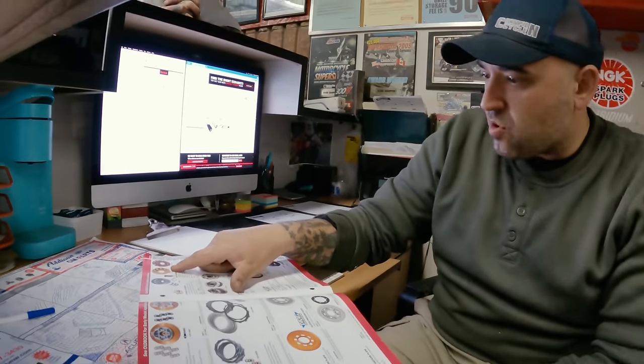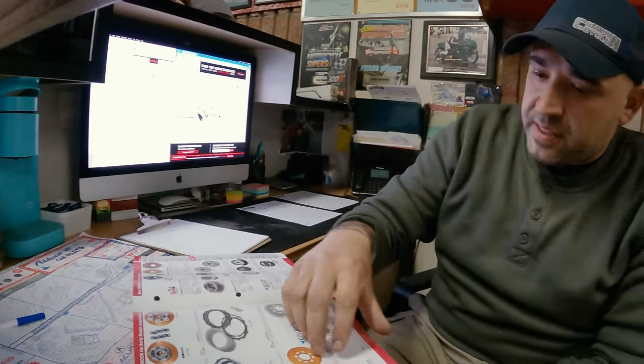The only thing that we found broke on his clutch was his stock clutch baskets. The stock clutch baskets are absolute trash. His clutch kept giving us problems and we couldn't figure out what was wrong with it. Then after we were switching his race clutch, which is this one, from the DR and putting it in the ST, we're like, oh, now we know why your DR's clutch has always been a pain. The actual clutch basket was cracked, had hairline cracks everywhere. So it was expanding. So we bought Alan's for his new one. This Trask basket. And then the lockup clutch.